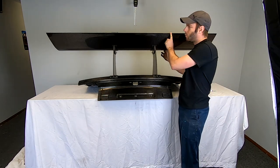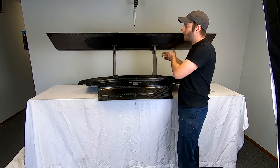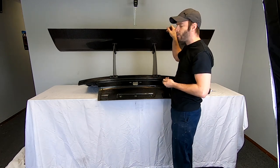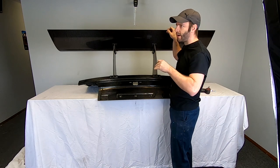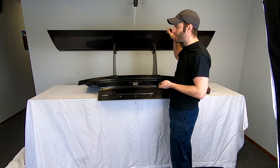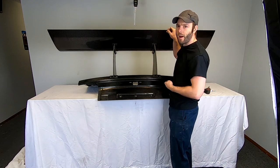When you first put a wing on and start running with a wing, it's usually a little bit safer to run the wing at a slightly steeper angle than you think you will need, because a car that has more rear grip is a little pushy — and a pushy car is a little bit safer than a car that might just snap around on you.